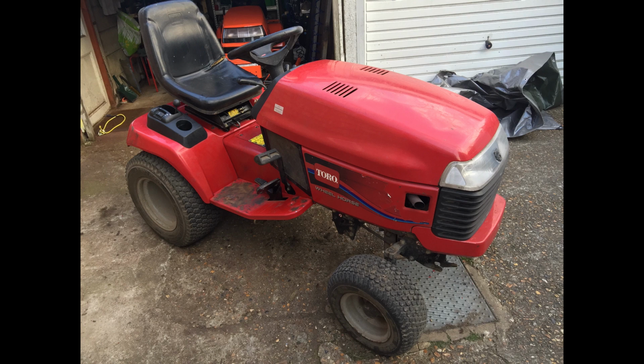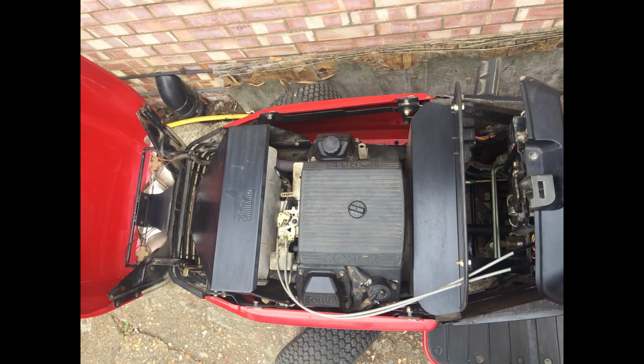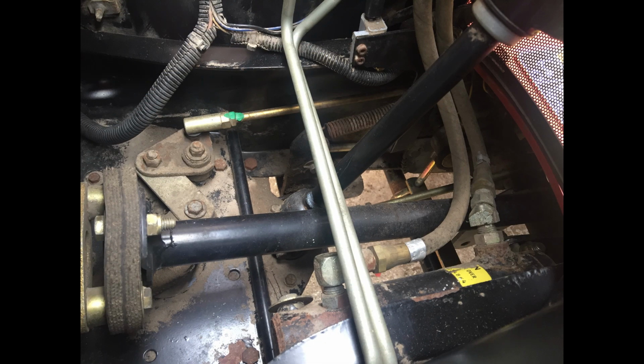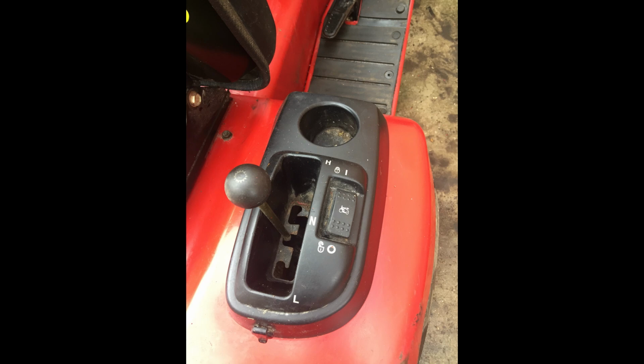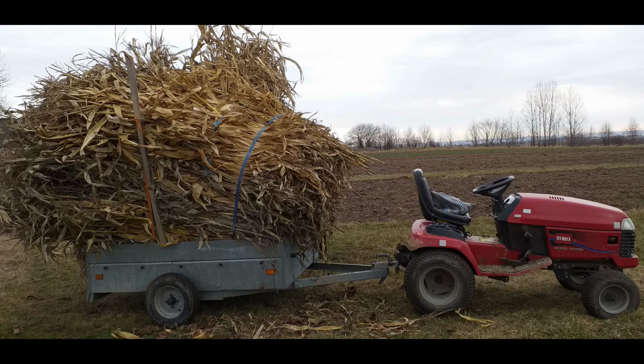In 1999, its price was approximately $6,270 and was equipped with a Kohler V2 gasoline air-cooled horizontal shaft engine. The gross power of this engine is 20 horsepower, squeezed from 624 cc and sent to the Eaton 11 hydrostatic transaxle via horizontal drive shaft. The Toro is equipped with a 2-range transmission, its maximum speed being 7.4 miles and almost 12 kilometers an hour, and is the heaviest tractor from today's comparison, 459 kilograms without any attachments.